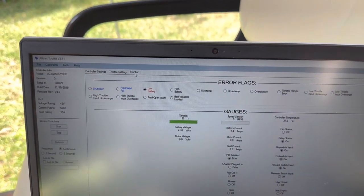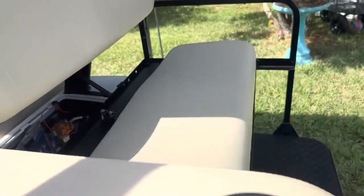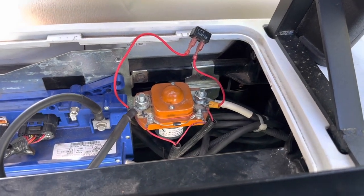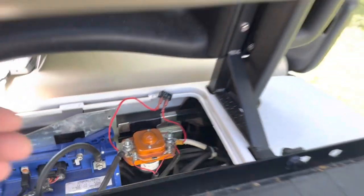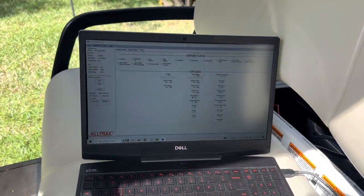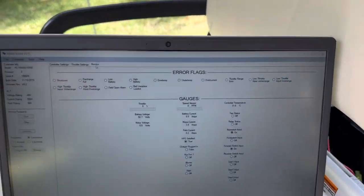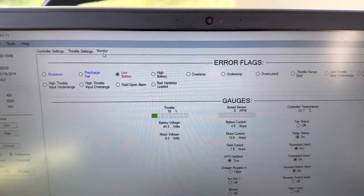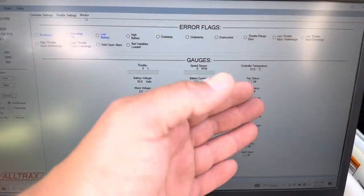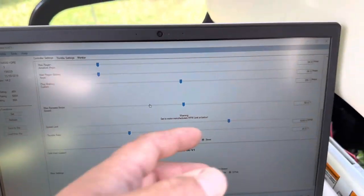Here's the issue we're having - low battery. It's not a low battery. You hear that click real late? This solenoid is either sticking or self-grounding out, so something internally is wrong with it. It happens - they're made in China. From there I was able to troubleshoot one thing after another. You see your throttle, so you know that's not the issue. You see your speed control - that's not the issue. You can go in here and disable all kinds of stuff, tune it, delete it.